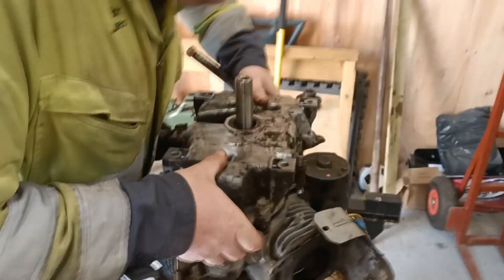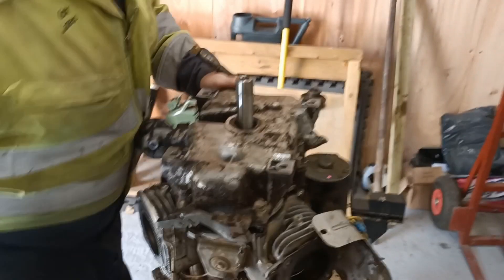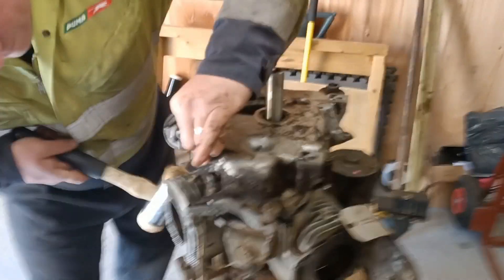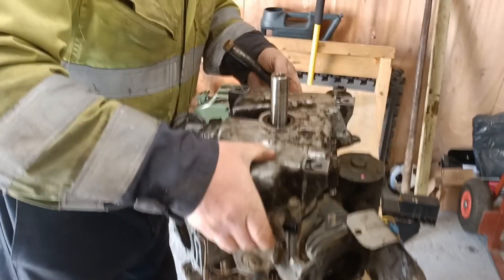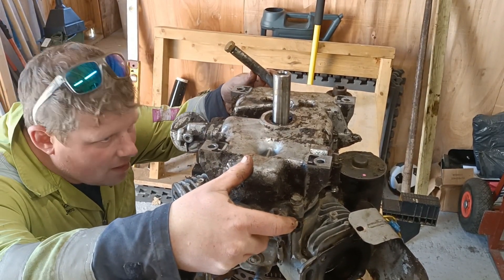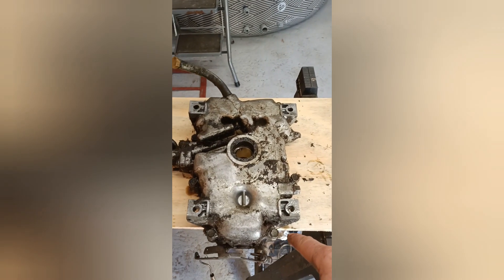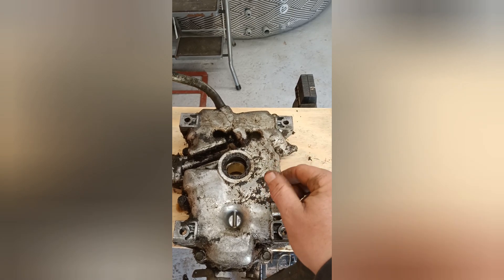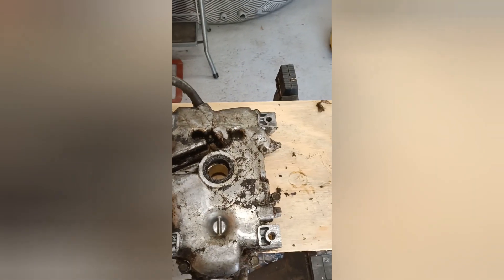Come on, you sod. I've got the sump off. Even though basically all of the bolts were loose, possibly on one on each side there was just the slightest bit of thread still in. So once I physically pulled them all out it popped off nicely off the shaft. And it is a mess in here.